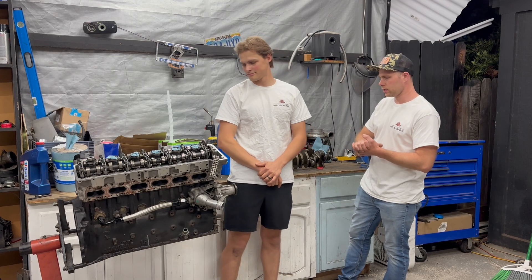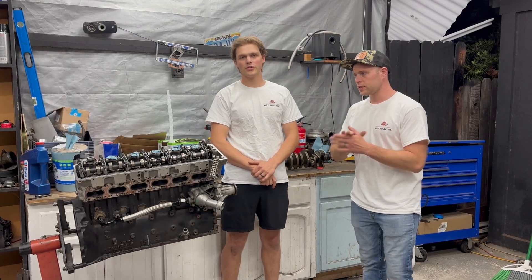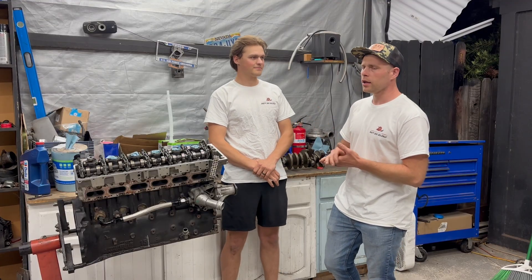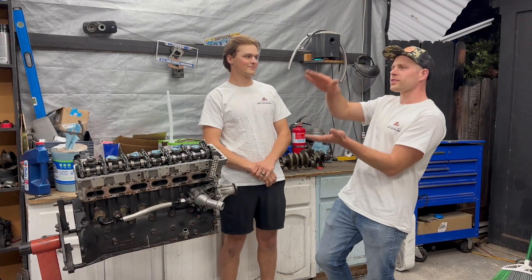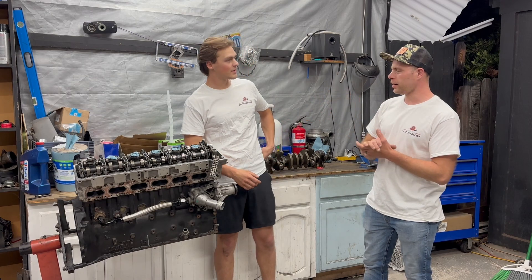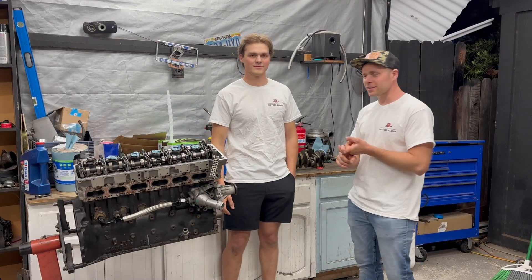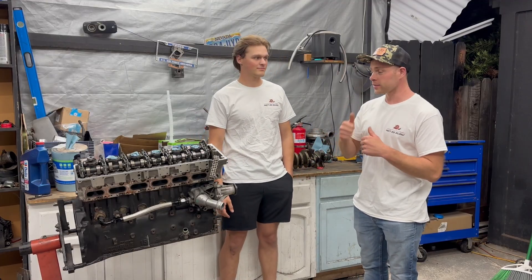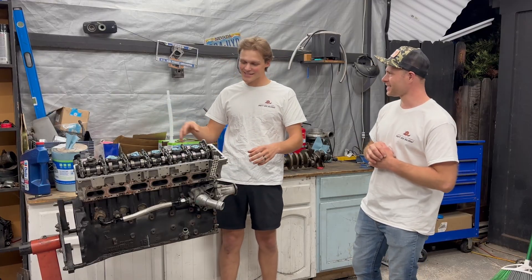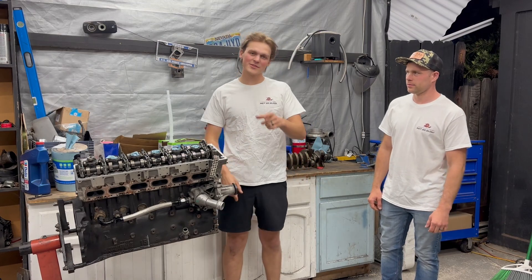Now we don't need to get a new block. You could tell there wasn't oil starvation because everything else was completely fine except just one rod bearing. Some people were suggesting to get the rear sump — we're actually going to test that to see if it's necessary. We haven't found it to be necessary in other 603 or 606 super turbo builds that pull really hard. That 606 in the SDL, with zero supporting mods — no valve springs, no crank pin, nothing — just injection pump and turbo, and zero problems. Like and subscribe because it really helps people find more content about these old turbo diesel Mercedes builds. See you next time — God bless you guys.